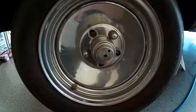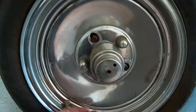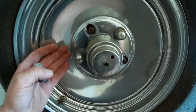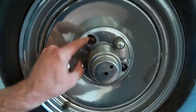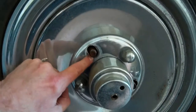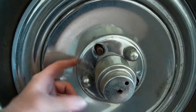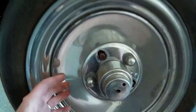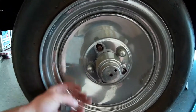So these wheels are truly hub-centric. I'm going to show you why and how you can tell that, and what the difference is between a hub-centric and a lug-centric wheel. Here we have the front driver-side wheel on our 66 Mustang project, and when I started pulling lug nuts I realized what I was looking at. You see how these lug nut holes are slotted? That's so that this wheel can be used on a couple of different bolt patterns — probably Ford and Chevy of the time. These wheels were probably manufactured sometime in the mid-80s.